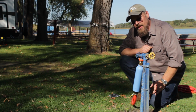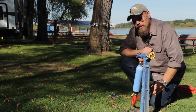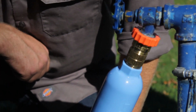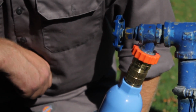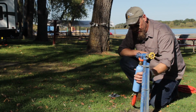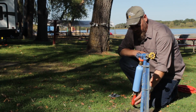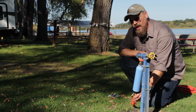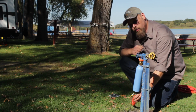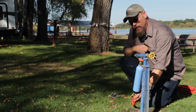The reason I say that is, did you leave that kitchen faucet open? It seems like a lot. Everything has a purpose. We need to make sure we only have 40 to 50 psi of pressure in the RV. We need to catch any kind of particle floating in the system, and we need a freshwater drinking hose, something that is rated for potable water to the RV.